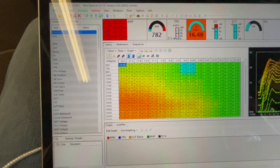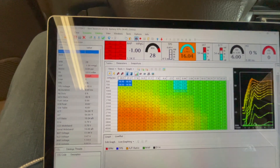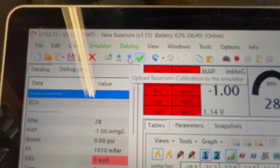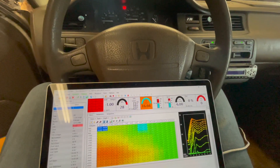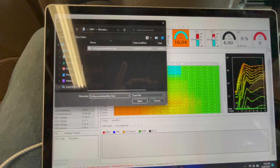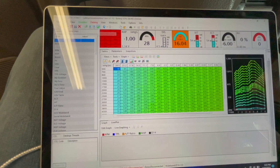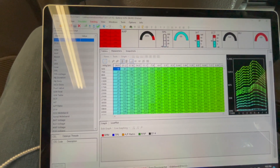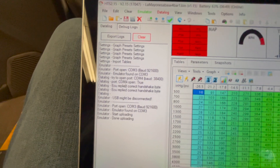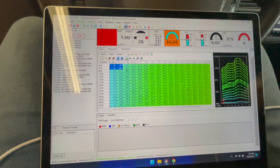It also shows down here that it is connected. If you click on the little gauge instrument cluster, it turns on data logging. So this in theory should start our car. This particular base map — to get it to the ECU, we need to upload it. So by clicking upload, it's going to send it to the ECU, and then we're going to be able to start the car. I'm going to open the base map that I had, connect to the ECU, and upload it. If you ever want to verify that your changes actually uploaded, you can click on the debug logs here and it'll show you a readout and a play-by-play. So once we're uploaded, let's go ahead and turn the data log on and start our car.